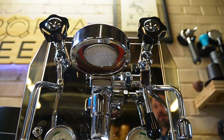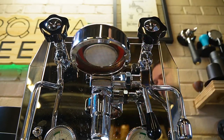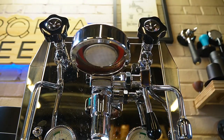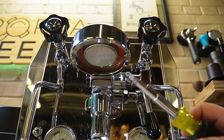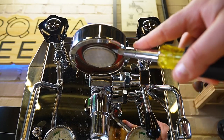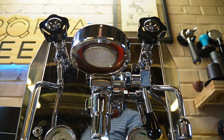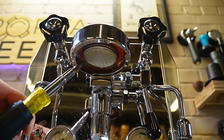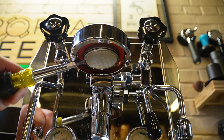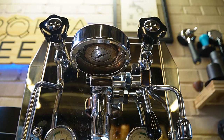Typically you'll get a little bit of buildup around the outer edge, usually on the screen itself. Maybe you're wanting to upgrade to one of the IMS screens or just replace your group head gasket. To get started, use a flathead screwdriver and align it in the ear grooves. There's usually a little lip on the sides of the shower distribution screen. Start on one side, pull down a little bit, then go to the other side. Usually it doesn't take much for it to just come out.